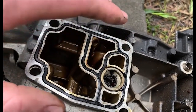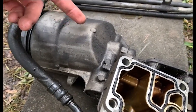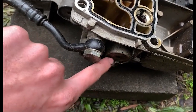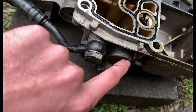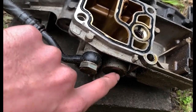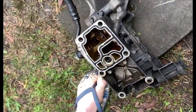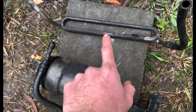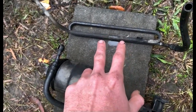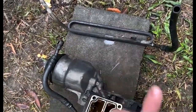So yeah, I'm not too worried about that, because M50s are pretty damn reliable as well. It's not like, to be honest with you, these things have problems with their little press-in bung cap things. These get pressed in on M52s, and on M50s they get threaded and bolted on, so it's a lot more reliable. These start to leak once you hit high mileage like I am on this car. And so yeah, we're just changing that over as well. But as for our power steering line, we should not have any problems, I don't think. It's purely because it isn't a very efficient cooler, and our line's pretty short as well. So I think we might be okay with that, I hope so.